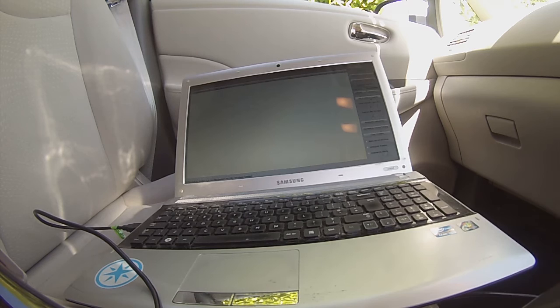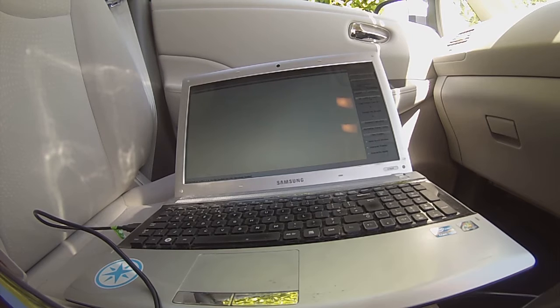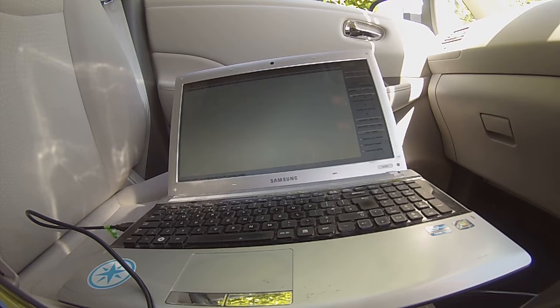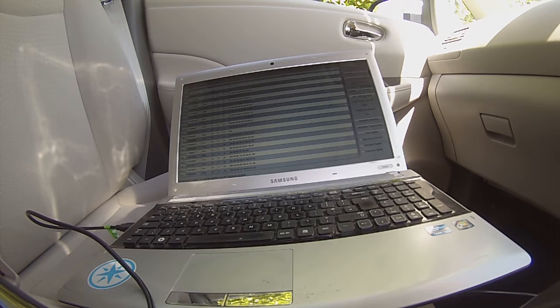And so right now I should be able to, of course where they put this OBD port is right in front of the brake pedal, so rather silly. So alright, so we should be able to, my foot on the brake here, which I can just about get without dislodging the plug, and we should be able to hit the power on button. And we're catching messages. Car is powered up and I'm at 770 to 780 frames per second.